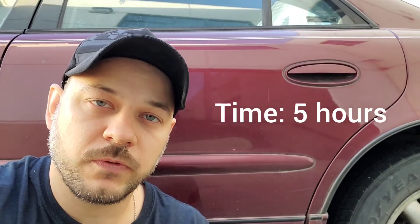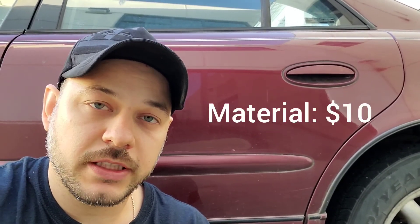I took the car for a test drive and everything seems to work well. I noticed before I would have a lack of power as soon as I pulled away from the curb, but everything seems good now. No trouble codes came up, no lights on the dash. The time on this job was about five hours. Every time I've had a check engine light related to the oxygen sensor it's always been the oxygen sensor, so this is the first time I've had to look for and address an exhaust leak. The paste itself was about ten dollars — really, the diagnosis is the expensive part. But that's how we get better: try new things and not be afraid to fail.